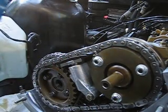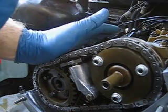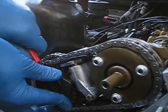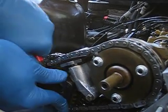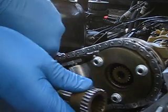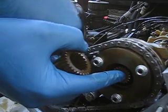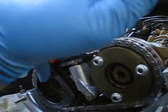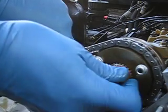This will allow the VANOS to operate properly, fully advancing the intake timing when it's activated. Though, when it returns to its default location, it will not be allowed to fully rotate. As you can see, all this space will not be allowed to be occupied by the splines on this, locking the camshaft in with the sprocket.